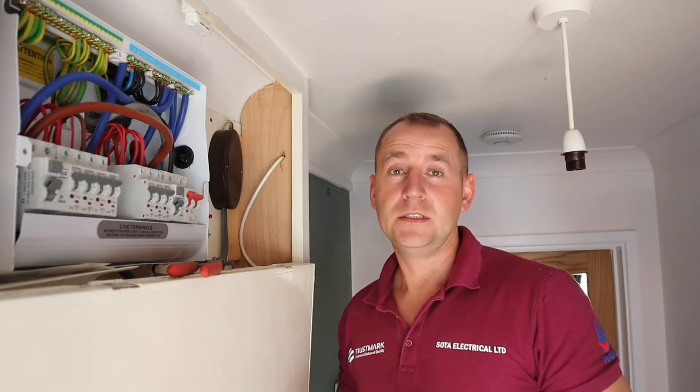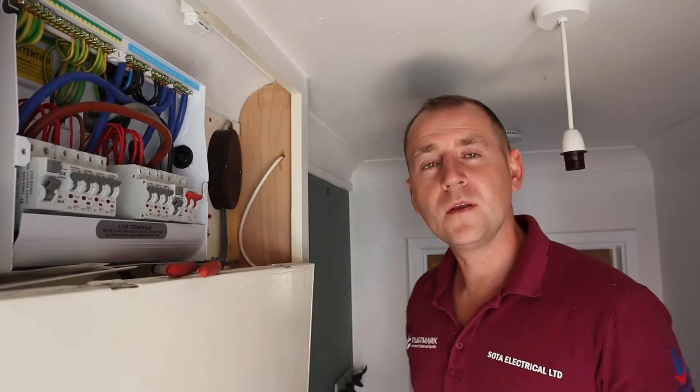There are three types of chargers out there. The first is a slow charger — this is a 3.7 kilowatt charge and comes off a 3-pin 13 amp socket in your house. The next is a fast charger, which varies between 7 kilowatts and 22 kilowatts — that's single phase and three phase. Finally, we have the rapid charger, which ranges between 43 kilowatts and 150 kilowatts. Not all vehicles can charge on a rapid charger — it depends on what socket your car has.